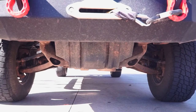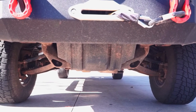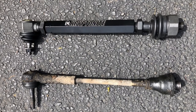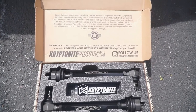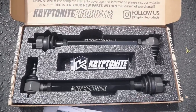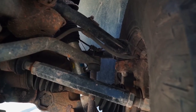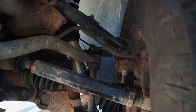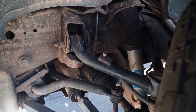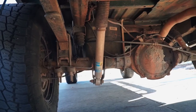In terms of lift, the only thing I run is a 3-inch leveling kit with blocks in the rear and the torsion keys cranked up in the front. From the factory, weak points in the front suspension are the tie rods — these are the Kryptonite series tie rods I chose to go with. I kept running into problems with premature wear from my ball joints, so I replaced my old upper control arms with some from Freedom Off-Road. They have a slight camber to them which helps the geometry. For my front and rear shocks, I chose to go with Bilstein 5100 series.